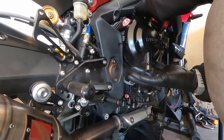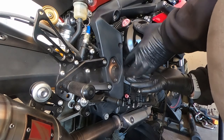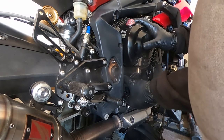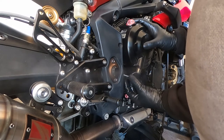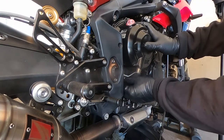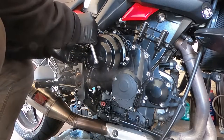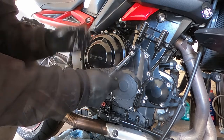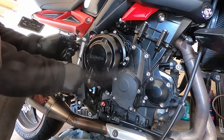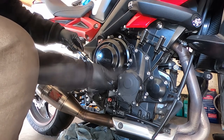I would suggest giving it a couple of goes, and if it doesn't work out, walk away from it and come back to it. After a few attempts, I finally get it to catch properly. You'll know you have it on correctly when the swivel arm only rotates to a certain point, because the actuator will make contact with the clutch piece. Now is a good time to inspect the gasket and make sure it's seating properly. I'll hand tighten all the bolts, then go through and slightly snug them in a crisscross pattern to apply even pressure to the case. Using the same crisscross pattern, I'll torque the bolts to 8 Nm.